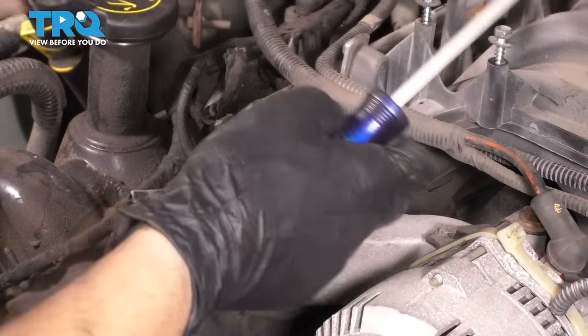And take this out. And now in order to remove this intake manifold, I'm gonna take out the 9 bolts that hold it on. They're all 10 millimeter in size. So I'm gonna start from the outside and work my way in. Some of them are different, so remember how they go. This here, for example, holds the thermostat housing in place. Take this line out of here.